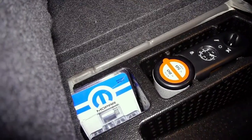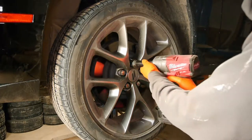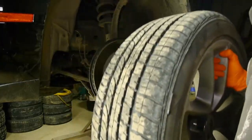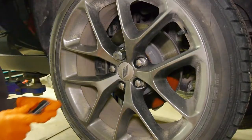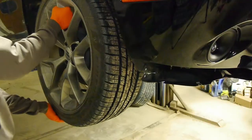If you have a special anti-theft nut, you'll usually find the socket in the trunk or in the glove box. I use a 22 millimeter socket to remove the lug nuts. If you don't have an impact wrench, loosen the nuts before you lift up the vehicle, otherwise you'll just spin with your wrench. Then you can easily remove them by hand.